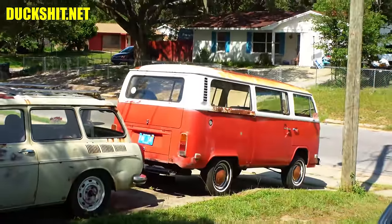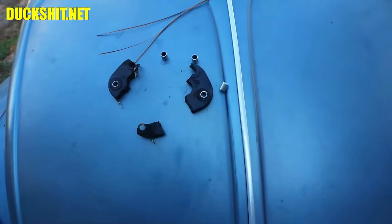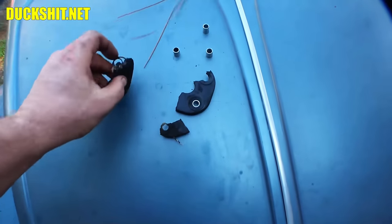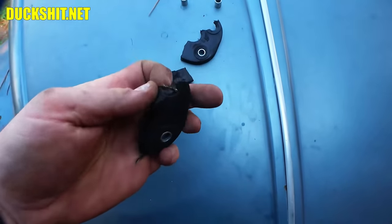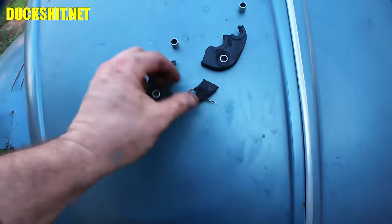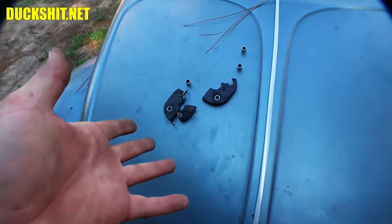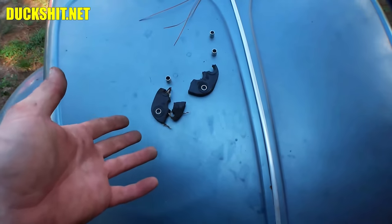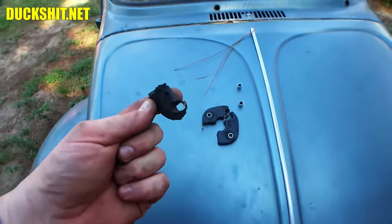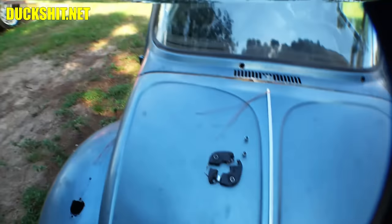About that bus. Well, that bus should be out of here by now, but we kept running into problems like the brand new steering coupler exploded. I don't know what the hell happened here, but clearly this rag joint, which is supposed to have a rag in it, just had a piece of string wrapped around each of these little collars where the bolts go, and that was all that was tying it together. Anyway, thankfully, I was only turning it around in my driveway, and I wasn't actually going down the highway at 80 miles an hour when it blew up. So a few of these pieces were still bolted into the vehicle, and the rest of them were just at the end of my driveway, and I only just found them when we had daylight the next day.